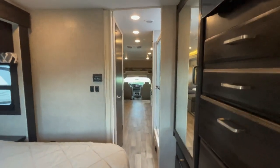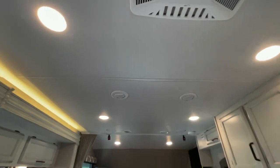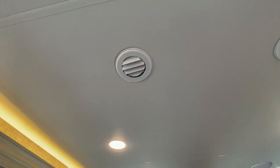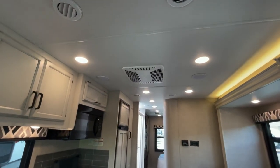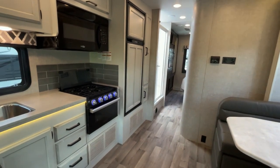This is one of my last 2022s. The ceilings are soft-touch ceilings, and they use T-molds for your trim, so the trim's not going to come down — the walls are placed inside on either side, kind of puzzled in, so you won't have hanging trim in a Jayco. The soft-touch ceiling is really nice because over the years with your AC you'll get some condensation around the ducts. With a plastic ceiling it turns yellow, but with the soft touch you can just wipe the condensation off. The padding also provides a little noise dampening — that fiberglass roof with the padded ceiling gives you insulation and noise reduction. That is the 2022 Greyhawk 29MV.